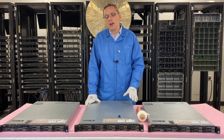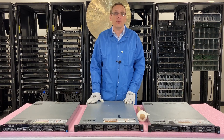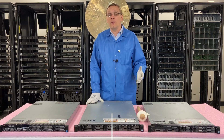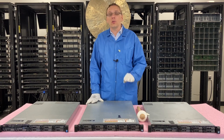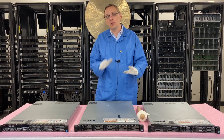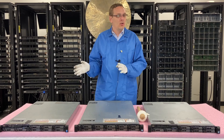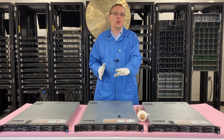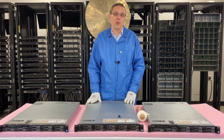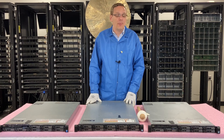One of the things I always like to point out — be very careful with the R630 because this could get you in trouble — there are actually different types of power supplies in the sense that some are for 220 volt and some are for 110 volt. Not every data center or rack is set up to support 220 volt, so you need to make sure the power supplies you're getting are the 110 volt so you don't run into any issues. Most stuff is 110 volt, but there is a good amount in the market that requires 220 volt, so make sure you don't accidentally buy that — because then you go to plug it in, think the power supply is dead, but it's not. You just got a 220 volt power supply and your hookup is 110 volt.